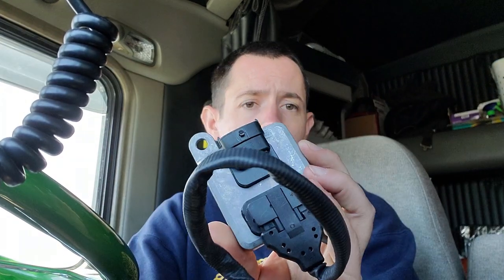I'll show you — the sensor comes in a box like this. It's a Cummins part. I believe even on the Paccar trucks, the DPF and all that is made by Cummins as well. There are two of these sensors on this truck. Most trucks that have a DPF have one up on the engine by the exhaust where it comes out of the turbo — that one has a shorter cord — and there's a little module on it.